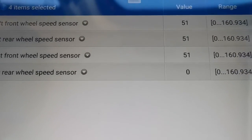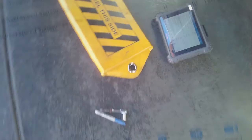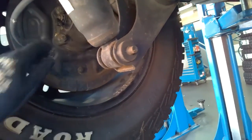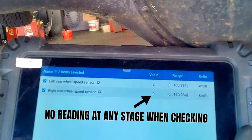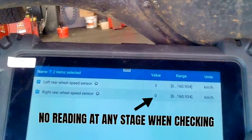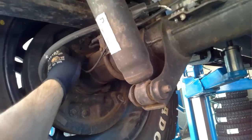As you can see, the right rear wheel speed sensor was completely dead — it was reading zero the whole test drive. So I bring it back to the workshop, put the vehicle in the air, and focus solely on the rear wheel speed sensors. I utilise the fact that I have a wireless scan tool and I manually spin the right and left rear wheels to see if I'm getting any reading, to confirm I wasn't missing anything during the drive. Manually spinning it, I can clearly see that nothing is happening at all under any circumstances.